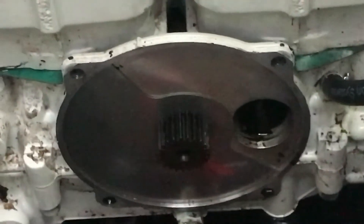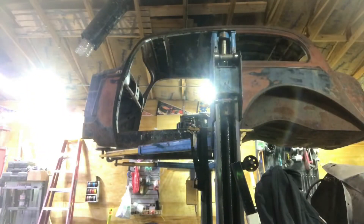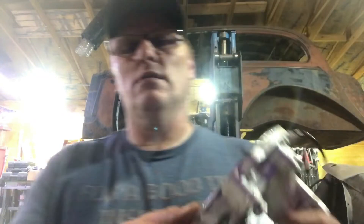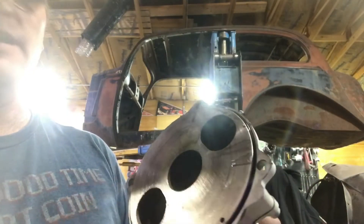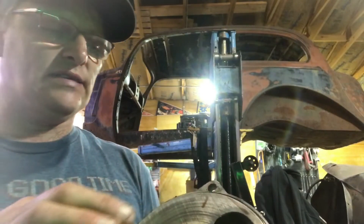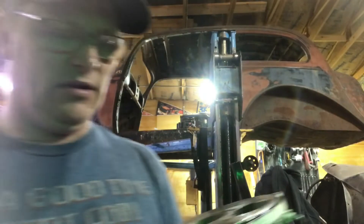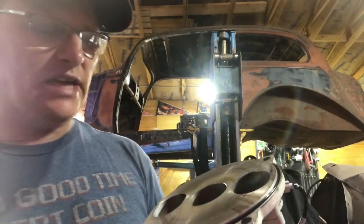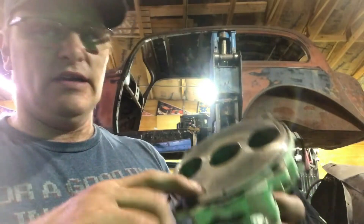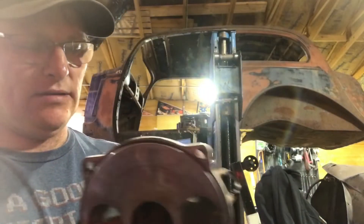Let me show you the cover. See these scoring lines on there? Your fingernail shouldn't be able to dig into them. We can sometimes machine these and get by for a little while longer. What happens is stuff gets shot through that motor — metal filings — and obviously with that shaft breaking, the brass gear chews up and gets between this and your rotary valve and really grooves it pretty bad. Hopefully we can clean this up and get the rest back on.